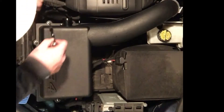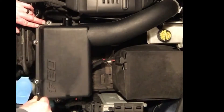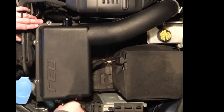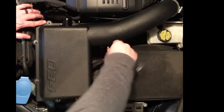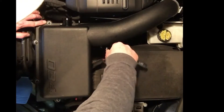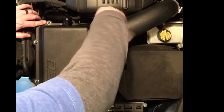I went ahead and snugged my last hose clamp down and I'm going to snug all of these. Now the 034 Motorsports intake does come with a high flow air filter, but because I already had the Racingline foam filter, I'm going to go ahead and keep that in there for now. Maybe if there's a defect in it, you never know — I don't have a spare.